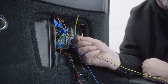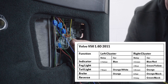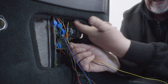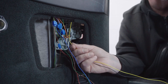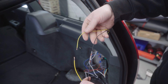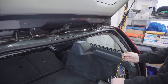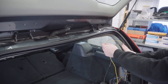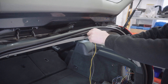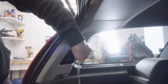That's all of the right hand cluster ones connected in. I've got two that need to connect into the left hand cluster — for the indicator and for the tail light on that side. I'm going to run a wire up and over the top coming out on the other side. To extend the wires I'll use solder sleeves, which are really useful — I'll put a link to them as well. I'll then feed it in over the trim and behind the seal going around the hatch so that it appears behind the cluster on the left hand side.